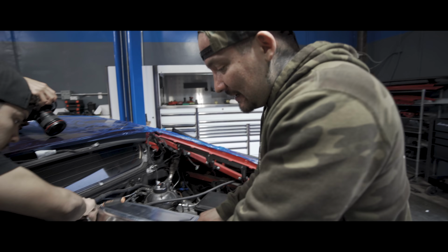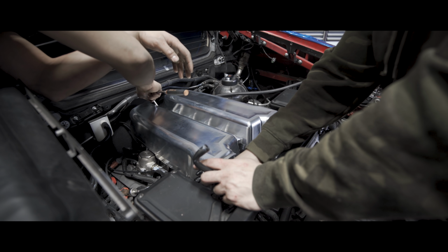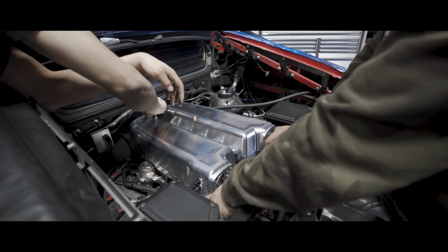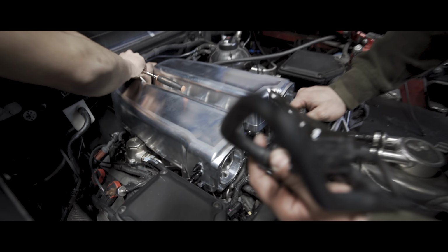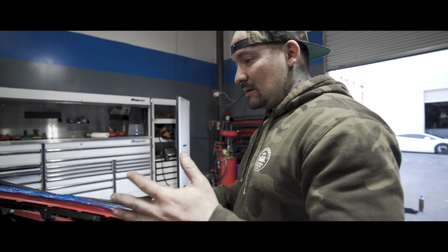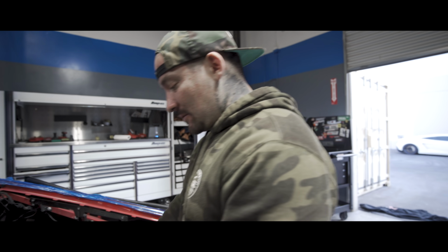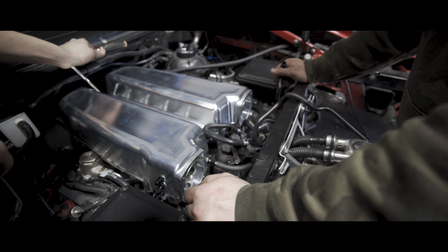On top of that, I added eighth pipe to dash four fittings on each side. So I have a boost wrap MAP sensor for each side and then blow off valves for each side. This bottom fitting is going to go to the other sensor that looks like this, and on this side, it's going to go to the brake booster. So we still keep a lot of the factory stuff. We just eliminate a lot of it and then clean it all up, make it look nicer. Because if I kept all this, just imagine all this stuff in here.